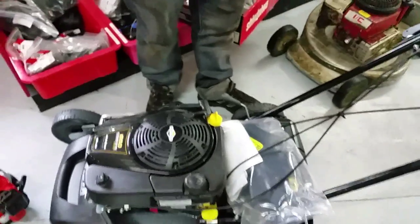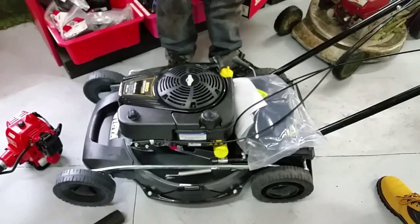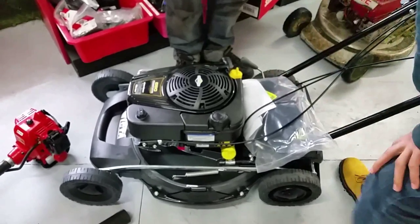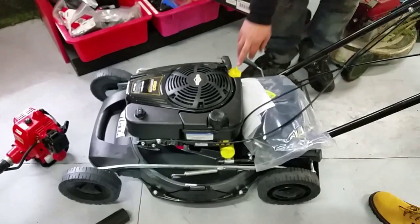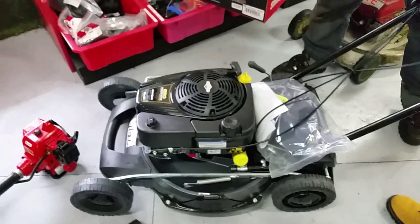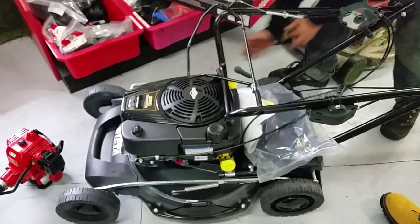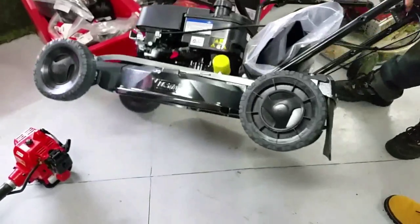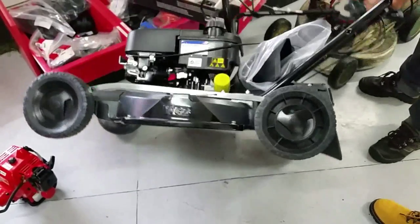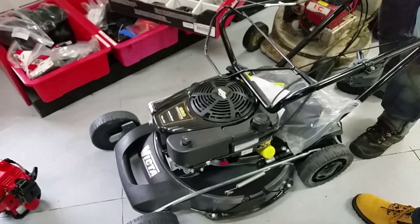When you're using both mowers, your weed eater, and your blower, that's probably about once a month. As long as you remember to do that, you should get a good long life out of this. The easiest way is to take the dipstick out, hold the handle, put an ice cream container down there, flip it over and let it drain out. Leave it sitting on its side until all the oil drains out.